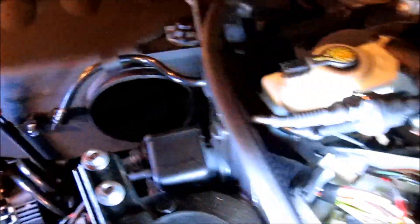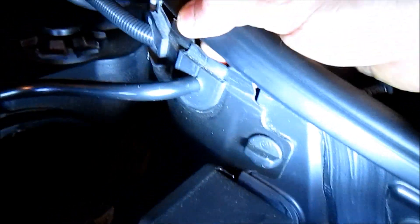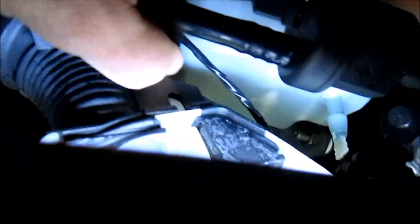Once you remove this hose from the plenum, it goes through this little rubber grommet. There's a rubber strip here that raises up. Once you pull that up, you'll be able to lift this up and pull it through. You'll notice that this little bracket connects there, and this is where the cover for the DME goes — so be careful not to lose that piece as it can come off.